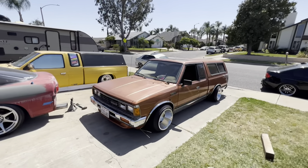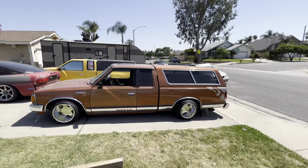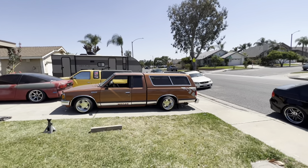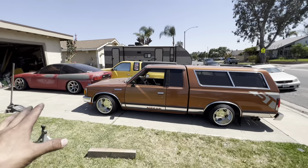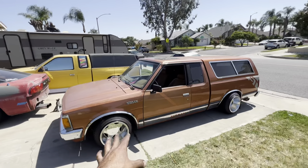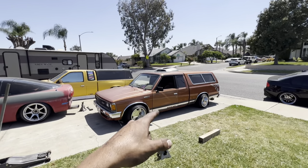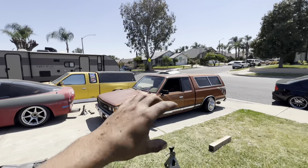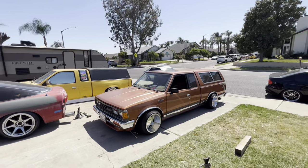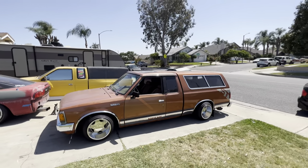We adjusted the ride height — the front is squared up and the rear is about half an inch higher than the front, which I like. I like a little rake; I feel like mini trucks should be a little higher on the back. My dad went and took it for a test drive and said he feels a huge difference — before it was actually bottomed out sitting on the bump stop. Now it's about a quarter to half an inch higher and actually riding on the torsion bars, so it's more comfortable. Hope you guys enjoyed this video and found it useful — definitely leave a comment down below.